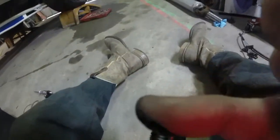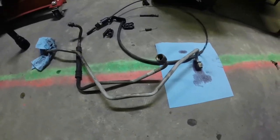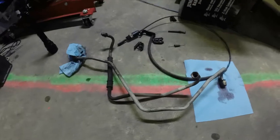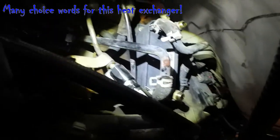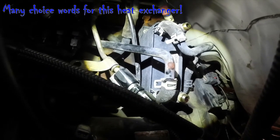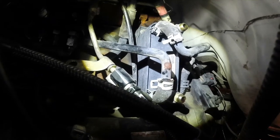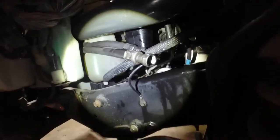It's pretty nasty. These transmission lines have just been kicking my butt the past little bit. I am pulling all the stock transmission lines out and going to run all new negative-eight AN lines. There's a heat exchanger in there that's pretty much kicking my butt right now — that's what I'm working on. I got the transmission lines off, now I just need to pull the coolant lines. There's another coolant line that runs down there on the block, and then I got my two lines disconnected up here going to the front cooler, which will no longer be used.